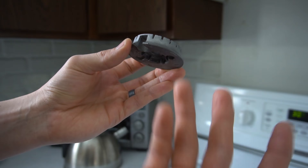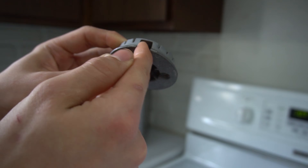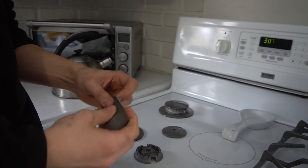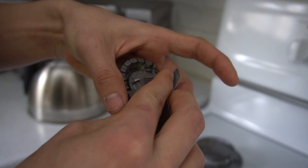Also, if you see that little notch on top there, that's where the spark is sparking — your sparker should be sparking to the top. Most burners will have that little notch or rivet up on top where the spark will go. So if you have gunk in here, all you've got to do is get some sandpaper — that's what I usually use — and just go between each of the slots and clean each one of them out. Or you could use the pick.